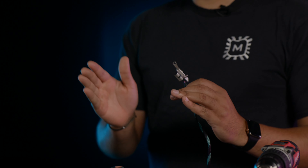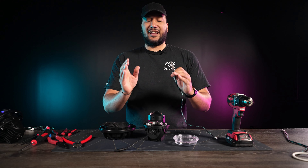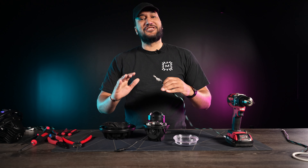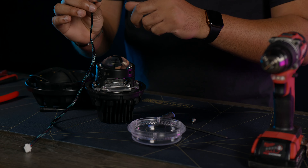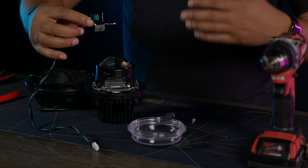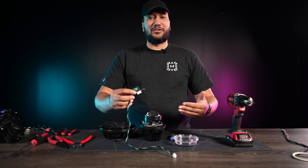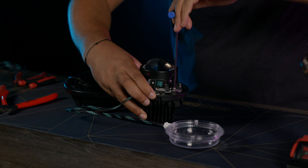You want to make sure that the demon eye is pointing downwards — you want it to shoot into the projector where it's not going to make the light spread in the incorrect direction. Before you just dive in and put this all together and wonder what happened to your lights, know that you're probably going to have to drill this out just a little bit to make it fit, and you're probably going to have to bend it just a tad to make it sit flush. This is the custom life of retrofitting — sometimes you just have to make it work.